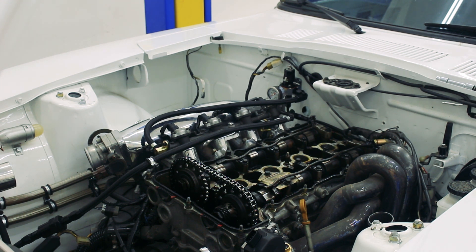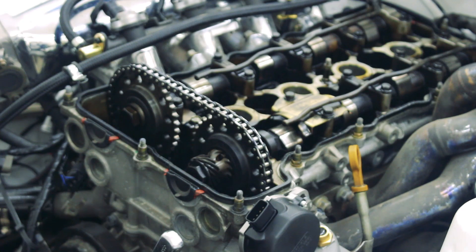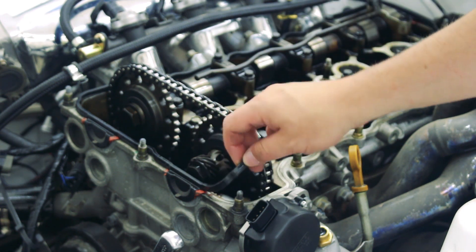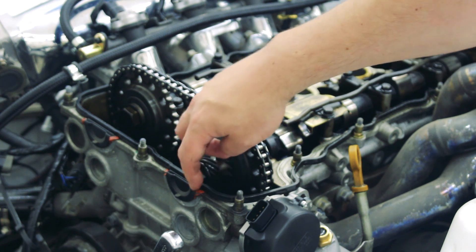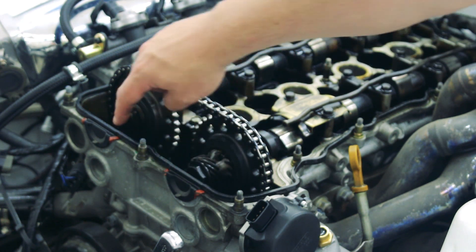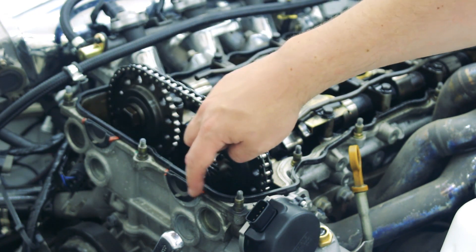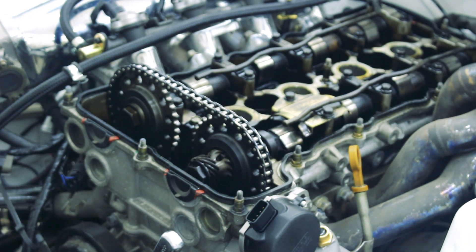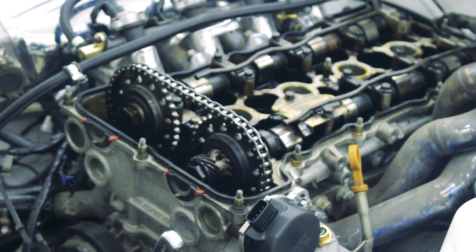Simply leave it where it is and you can rock it back into place if you're gentle on the reinstallation. On my head here you can see where silicone was used to secure the d-shaped portions of the seal. These are notorious leaking points and silicone is often used to prevent a leak, but it also causes the gasket to be locked in place. If you leave this in place on your head while you're working, simply be careful not to lean on it with any tools that may break it, and ensure that when you go to do the reinstallation it is in the proper place and pre-slid into the groove before you attempt to clamp down the valve cover.